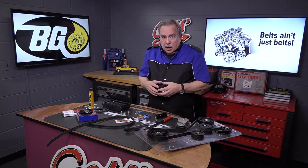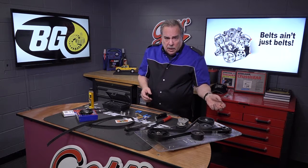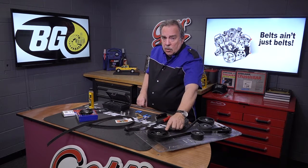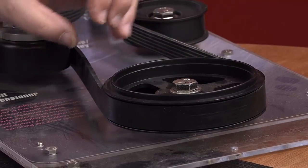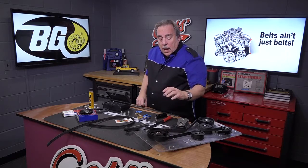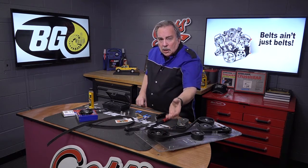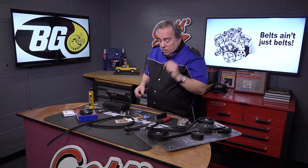That's a really positive way to check, and I'd highly recommend it because otherwise you could wind up replacing all sorts of things and not getting the problem solved. One of the more common problems is the crankshaft pulley at the bottom, which is often made in two pieces — a metal inner piece and a metal outer piece with rubber between them. That rubber deteriorates over time and then the pulley portion moves on the hub portion, putting everything out of alignment.